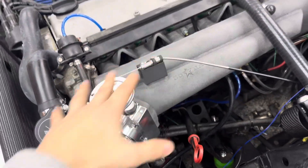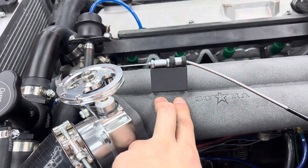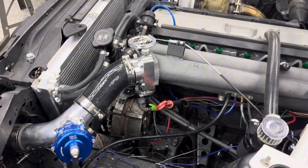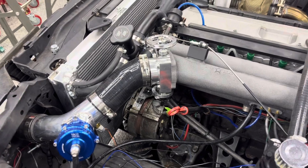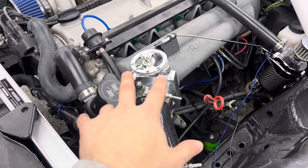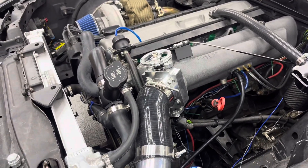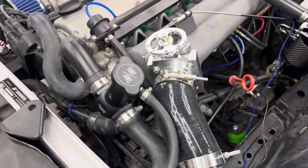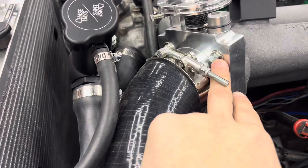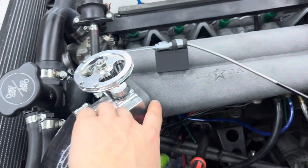With this current setup it's much, much better. Originally the manifold comes tapped with two little screw ports, and I had a piece running down to mount the throttle cable, but it just wasn't working well. That throttle flange was a 70-millimeter S90 throttle body flange, which means the mounting holes aren't symmetrical — they're longer than they are wider. That was mistake number one; I should have asked Victor to cut it off and put a different flange on. I got rid of that S90 throttle body and got a universal 65-millimeter one on Amazon. I was able to drill out the mounting holes and use a washer to mount the throttle body up, which is very nice and secure using the stock S90 mounting holes, and I was still able to run a gasket in between them.